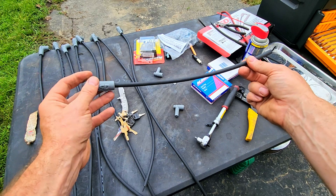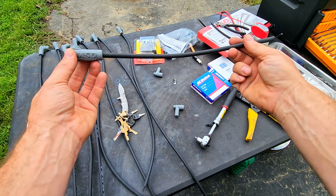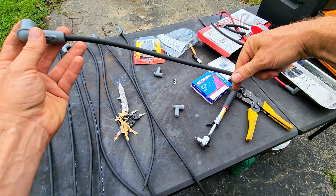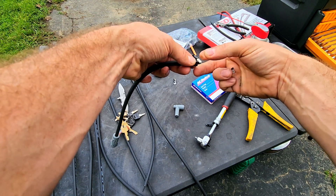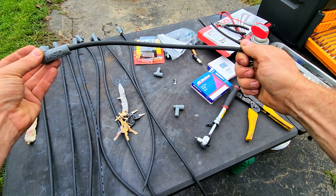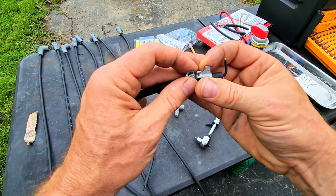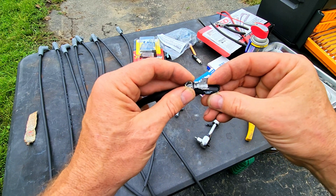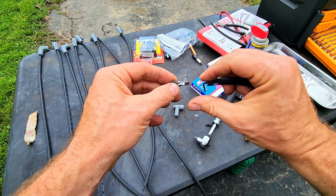As you're making your wires it's very important to pay attention to orientation, because you don't really want to have to twist this heavy-duty wire. This will go to the coil like this, and right here will be the top of the cap. Pay attention to orientation when you put these guys on, so that when you crimp it down you're not having to twist the wire — it can go directly down on there. You can crimp the wire straight or fold it over and feed it. I've done it both ways and had the best luck folding them over.